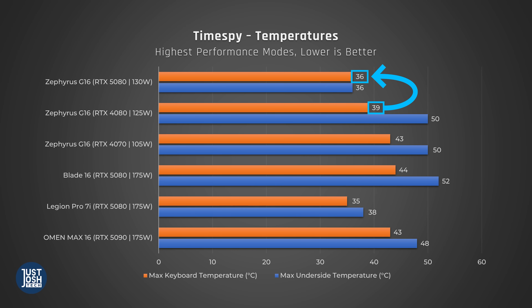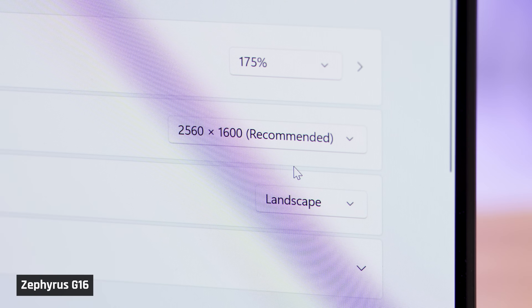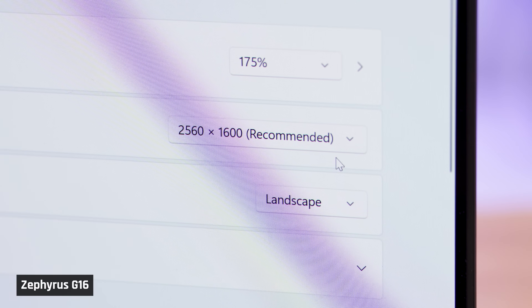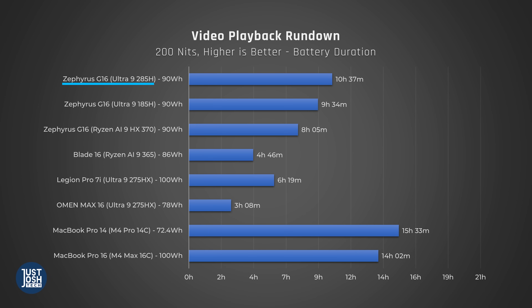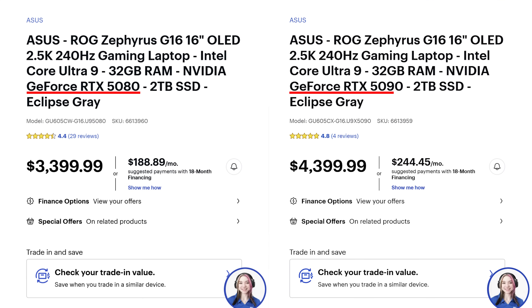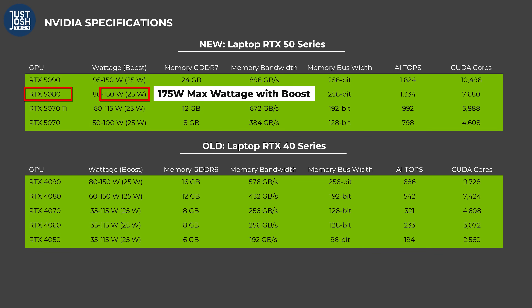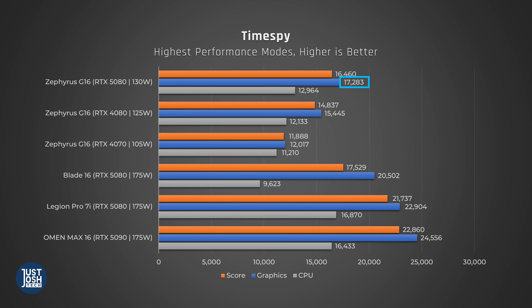This year's G16 is actually much improved from last year's. It feels noticeably cooler to the touch, and the 5070 Ti version has more VRAM than the older 4070, which is better for driving that 2560x1600 resolution display. This year's G16 also has noticeably better battery life. But before you run out and buy one, I'd avoid buying an RTX 5080 or 5090 config — you'll just be throwing money down the toilet. The GPU's wattage in this laptop is capped way below the 175 watts that others run this GPU at, so the Zephyrus G16 significantly underperforms competitors with a 5080 or 5090.